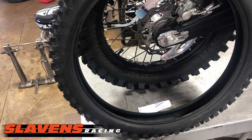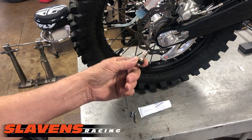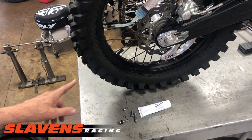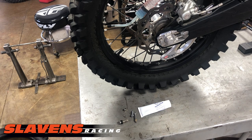You don't really need to go through the hassle of lubricating the mousse and wrestling it in there. That's my tip of the day for mousses. If you install the valve core before mounting, you can re-lubricate without dismounting — squirt lube into the crown of the tire just like on the initial install. It will dissipate and find all the little nooks and crannies inside the tire and mousse combination.